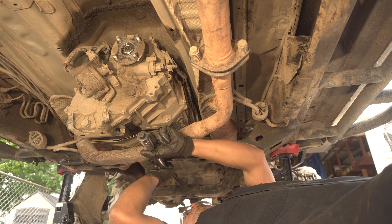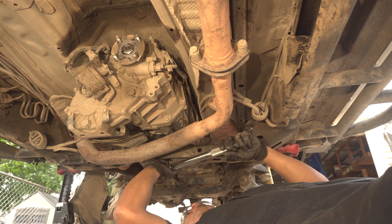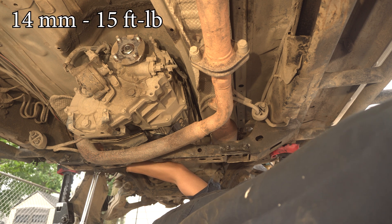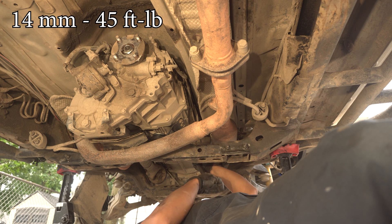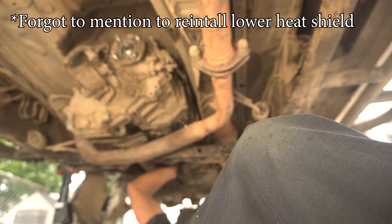All right, we'll start with tightening these bottom bolts to 30 foot-pounds — these are 12 millimeter bolts, and we definitely want to tighten these down in a cross pattern. Then we'll tighten down these long bolts to 15 foot-pounds. And we can tighten down those mounting bolts on the transmission to 45 foot-pounds. So that's pretty much it for this video guys — hope you enjoyed it. Make sure you smash that like and subscribe button. Until next time, peace out everybody.